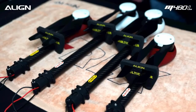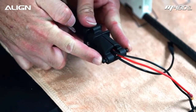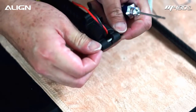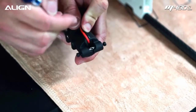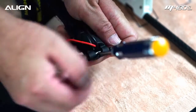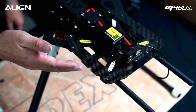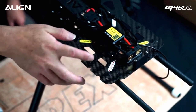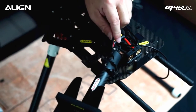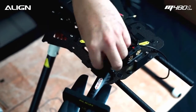Notice the M1 to M4 labels on the tubes and locate the M1 tube assembly. Temporarily remove the two 3x6mm screws. Notice an opening in the threaded sleeve — stick a screwdriver inside to prevent it from rotating while removing the screws. Locate the stickers on the frame, notice the two arrows pointing to the screw holes, confirm matching stickers, and mount the motor tube assembly to the frame. Temporarily fix the arm in place with the twist-off screws.